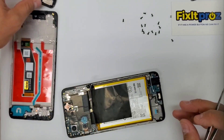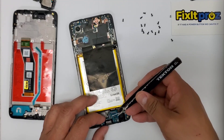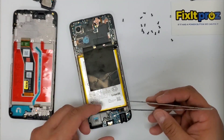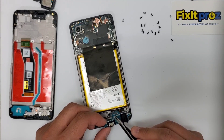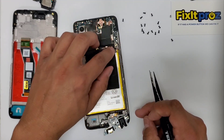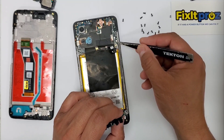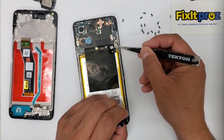Just in case you need to replace the speaker, it's pretty easy. Same thing with the charging port — this will pop out here. So if you just need to change the charging port, disconnect the battery, do up to here, change the charging port, and be careful taking these little antennas off. You don't want to break the connector from the charger port. I like to just leave it in place and pull this out carefully. Sometimes these things are really glued in and you end up ripping the antenna from the actual little socket — then you've got to get a replacement one.